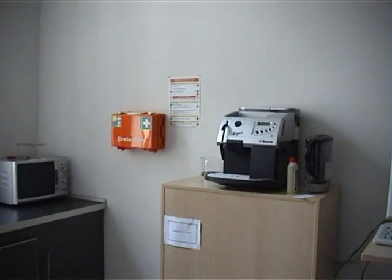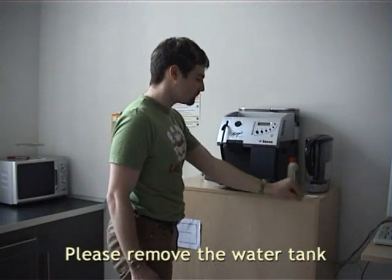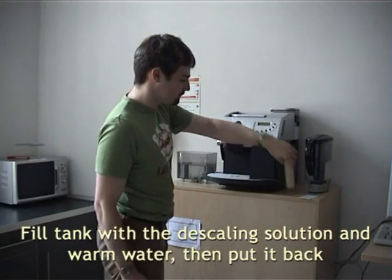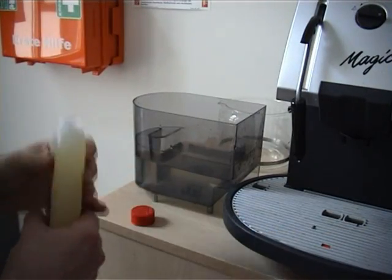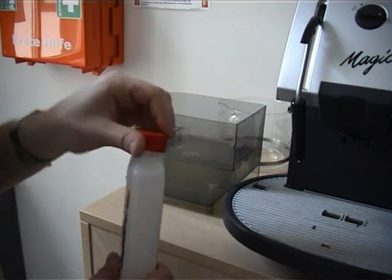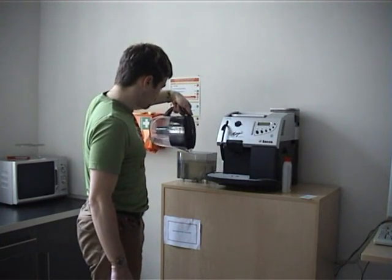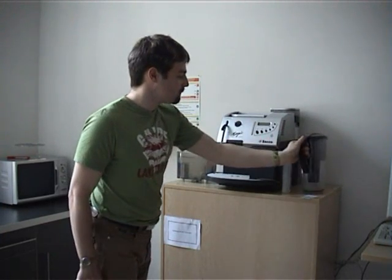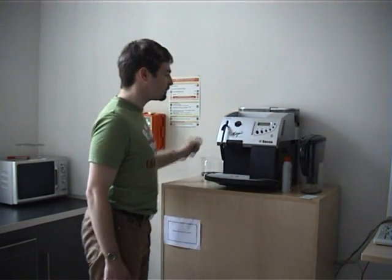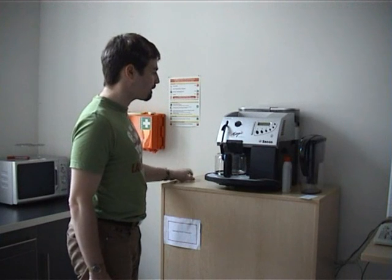From time to time, the machine needs cleaning. To start the cleaning process, the user swipes a special RFID tag over the reader. Most of the process happens automatically. However, some steps require user intervention and the system assists the user during these steps. After the built-in sensors of the coffee machine have detected that a manual step has been completed, the cleaning process automatically continues until the next user intervention is required. The system detects the RFID tag on the water pot and starts cleaning.